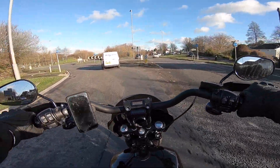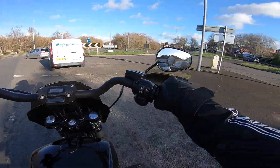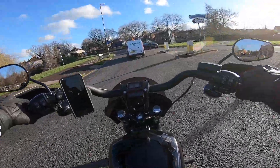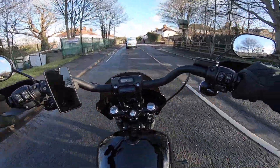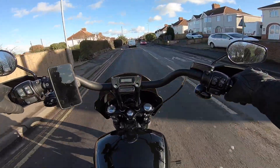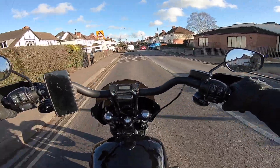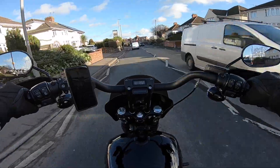One thing I did learn is there's no such thing as grease on a new tire — that's actually a myth. Most molds these days are made through Teflon or similar materials, so the tires come out like a cake with no grease involved. They might put a little bit of lube on the sidewalls to make sure the lettering is perfect, but that greasy thing is not true. All it is is that your tires are just super smooth because they come straight out of the mold. The plan is simply to get them nice and rough — take it easy for the first 100 miles and progressively get quicker and more aggressive.